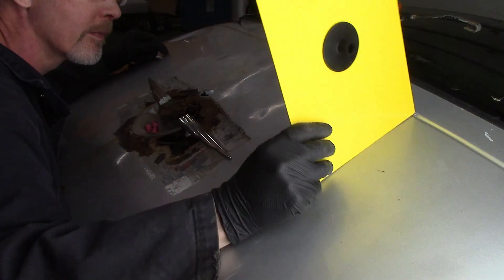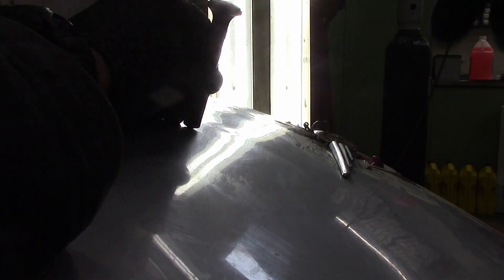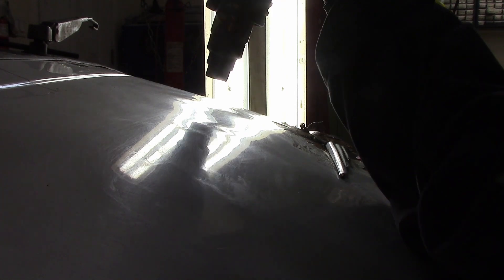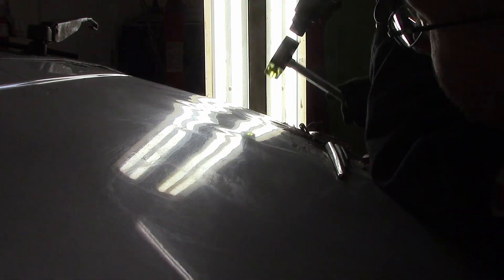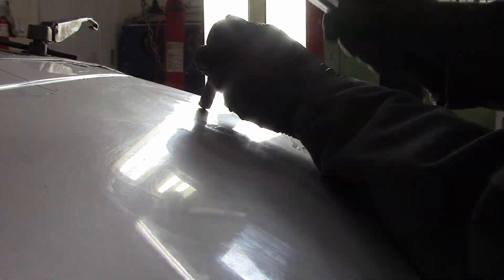The kit came with a wee soft-faced hammer, which I do find I enjoy for persuading dents out in a progressive and gentle kind of way. Here you can see lines from my vertical fluorescent tubes to help you see where the high and low spots are — you can really see how wrinkled this panel is. I've watched videos of guys just gently persuading it to perfection with these little dent-drifting things, and it's magic. It didn't really move at all for me, but my enthusiasm for bodywork is pretty low, to be honest. I'm quite happy taking things to an acceptable level of filler or a thick coat of paint.